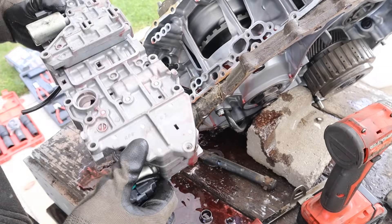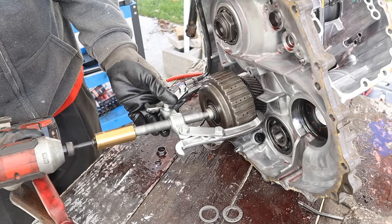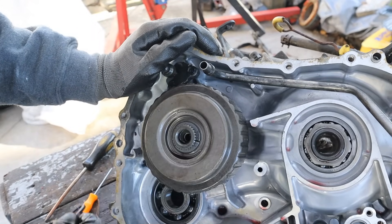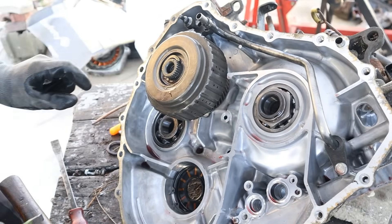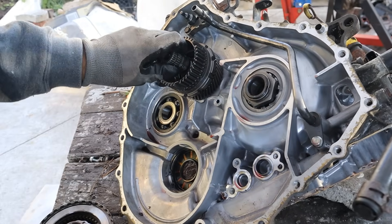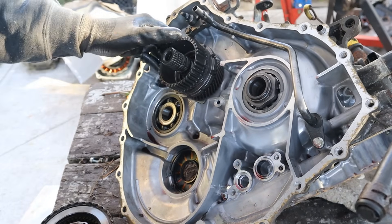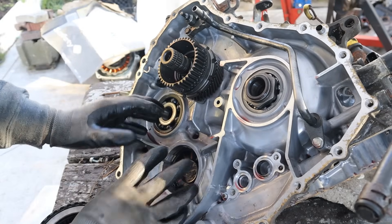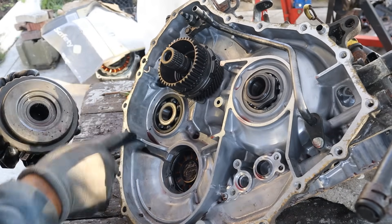Back at the front of the transmission, I'm trying to get this clutch off. After reading the instruction manual, it turns out there's an extra cover keeper and two more C-clips to punch out. It appears that clutch pack is going to connect the output coming from the second variator to this gear over here, which spins the counter gear and ultimately spins the final drive. So it's like a neutral disconnect — once you connect the clutches, the power can be transferred.